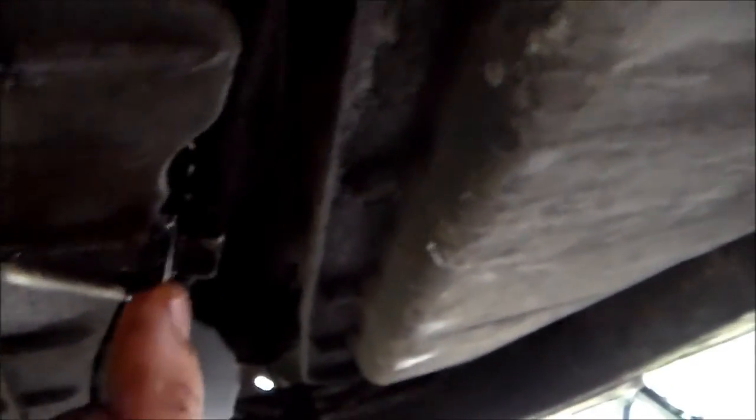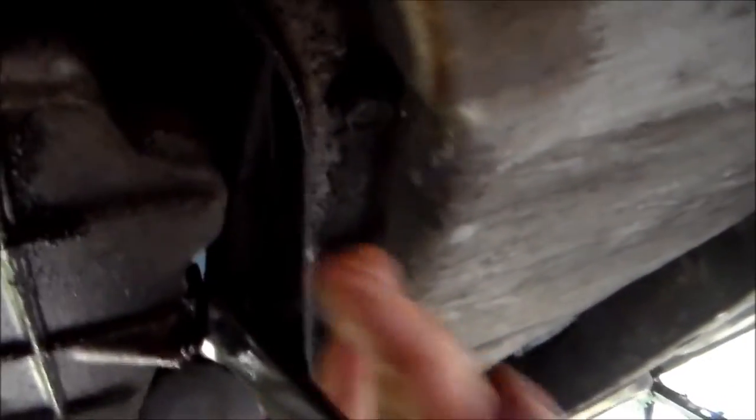Since this is down to just barely a drip, I'm going to put the drain plug back in. Now, this is an aluminum pan. Most generally on these GMs — these Buicks and Oldsmobiles and Pontiacs — it's just a 15mm wrench. You do not have to get on here and wrench hard on it; you will strip it and cause problems. Just get it like that — don't get clear out and yank on it. And that's all it takes. If it leaks after that, your little grommet on your bolt is causing that. It doesn't have to be super tight. Just bump the end of your wrench once, and that's going to be good enough.